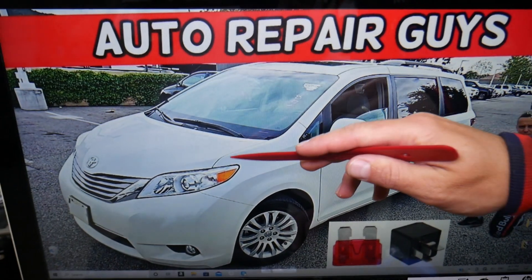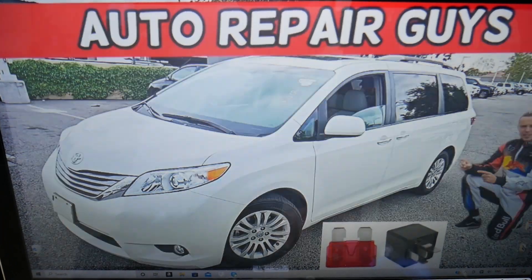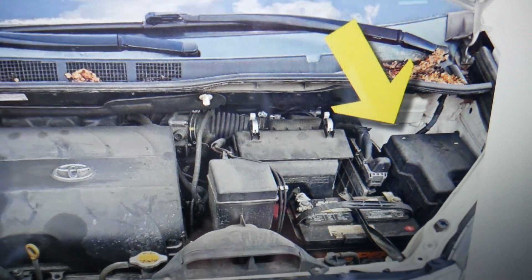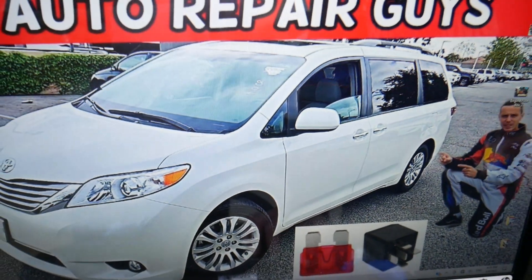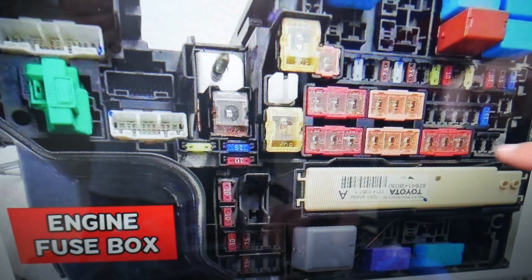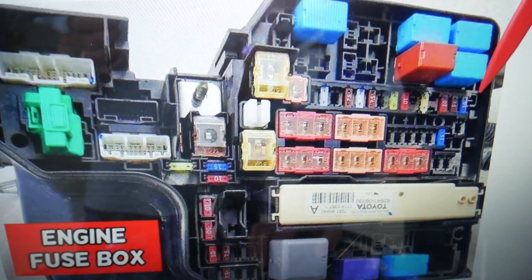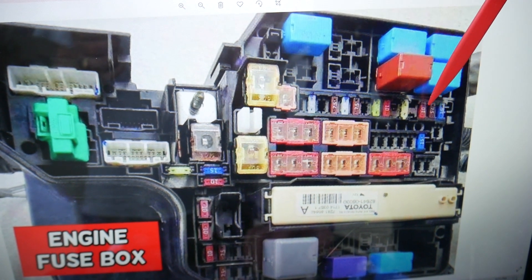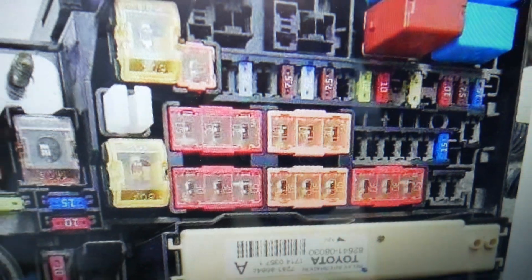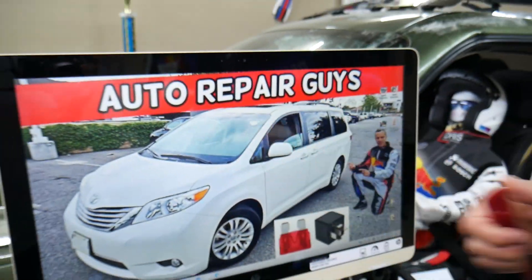After that, we need to go to one more fuse box under the hood. Open the hood and, facing the engine on the right side, you have a fuse box under a cover. Open that cover and you will see a fuse box layout like this one. Zooming in on that row of fuses — fuse 36, 37, 38 — fuse 38 right here will also need to be checked. Hopefully this video was helpful. Thank you for watching. See you next time.